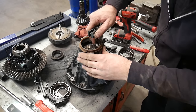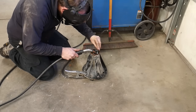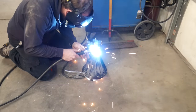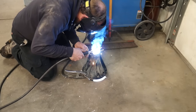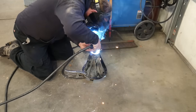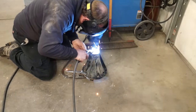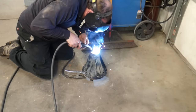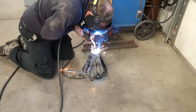The method I chose to use was welding a bead around the race. This is a trick I saw someone else do — they just welded a bolt to it so you have something easier to grab onto. I tack welded the bolt first and then welded a continuous bead around the center of the race. Make sure you don't weld the race to the housing. The results will be better if you use a gas shielded MIG welder; an arc welder or a flux core MIG welder will leave a lot of splatter and slag to clean up. What this does is weld extra material to the inside of the race, and as that material cools it shrinks the race and it should fall right out.